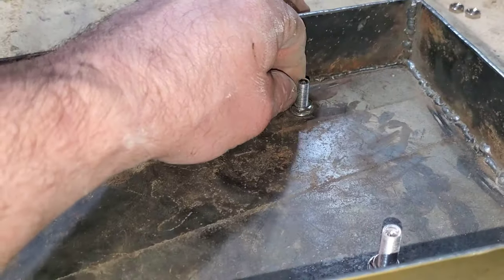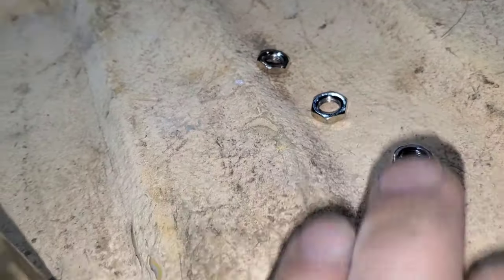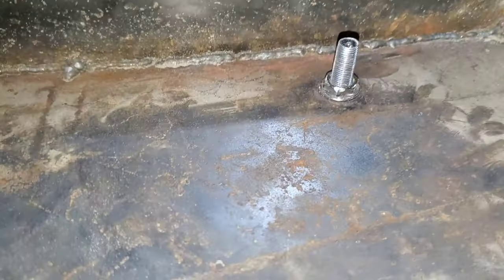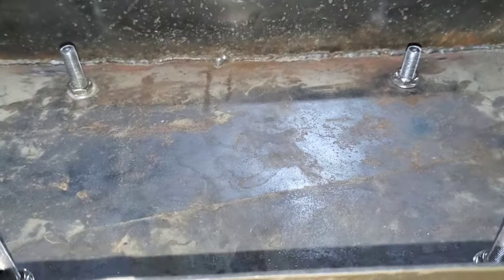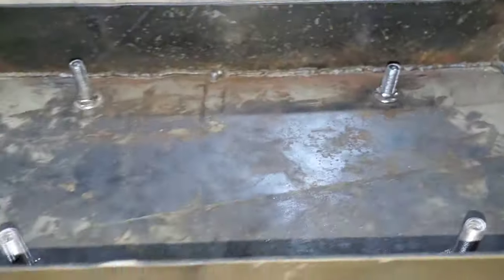Alright, I had all this together and decided that I would double-nut this one. What I did is I just took it back off and put that nut on this side right here, and I can use a 12 millimeter to hold that. Then I can put the nut on this side, tighten that down, and it won't stand off nearly as tall. It's fully adjustable now so I can get it to whatever height I want. This is not my vehicle — it will give the owner plenty of thread there to put whatever he wants on.